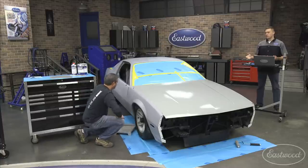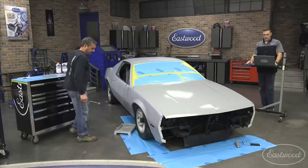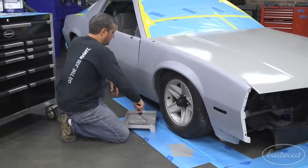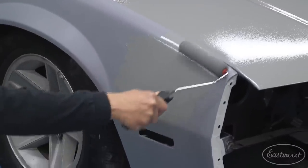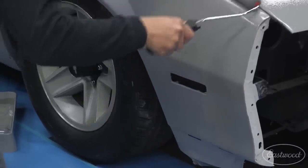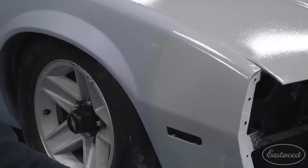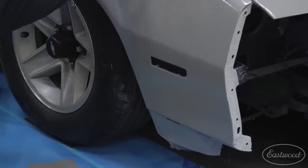With these kits you don't need any special tools — no big air compressor, no spray booth. As you can see, we're not getting any overspray, so you're not covering your toolboxes or anything sitting nearby. I'll get in here on that fender with the little roller. Same thing — new roller, meter it out. And that's how easy it is for the verticals. This is the little one-inch roller.